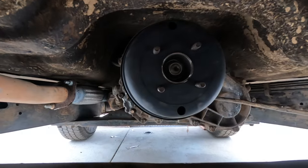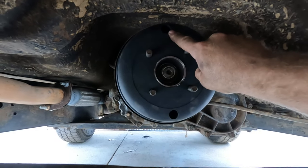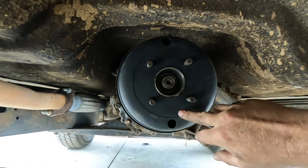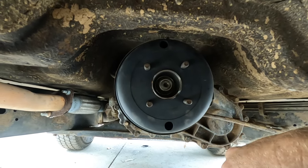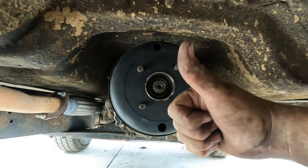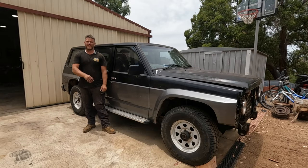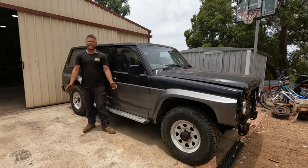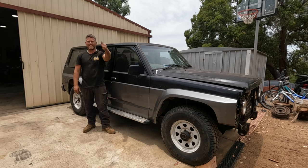Back under the patrol now — put those rubber grommets, at least one of them, back in for now and reinstall that drive shaft. Double check your adjustment again, but otherwise that should be pretty good. I'm glad I got that job done — it's just another one off the list for the old girl. I hope this video helps you out, even just with adjusting your handbrake. I'll put a time-lapse and all the parts I used in the description. If there's anything I've missed, please throw it in the comments to help others. Take it easy!